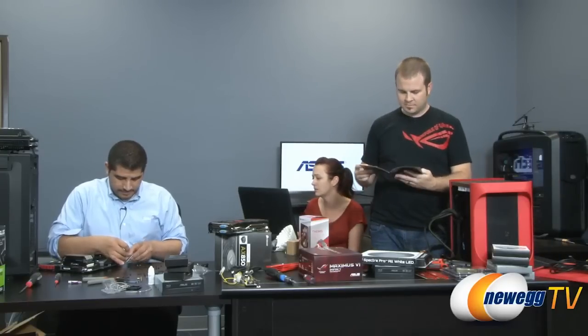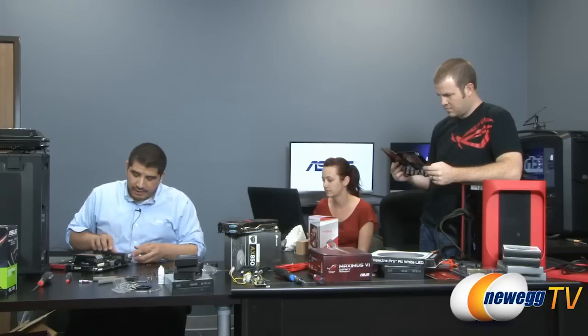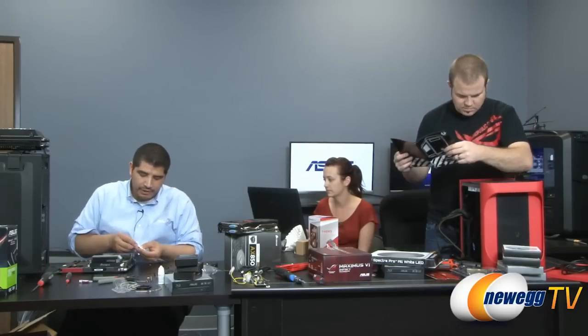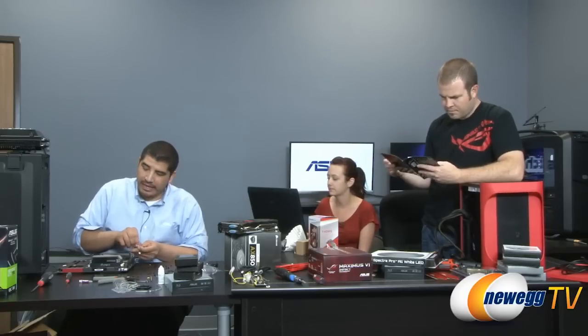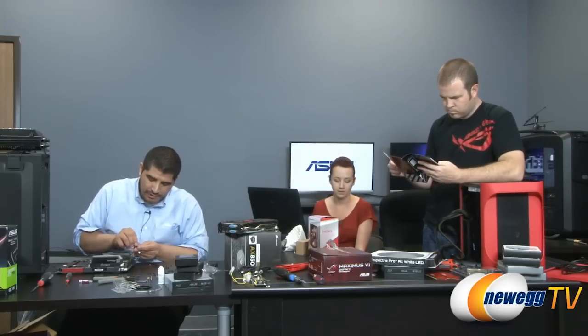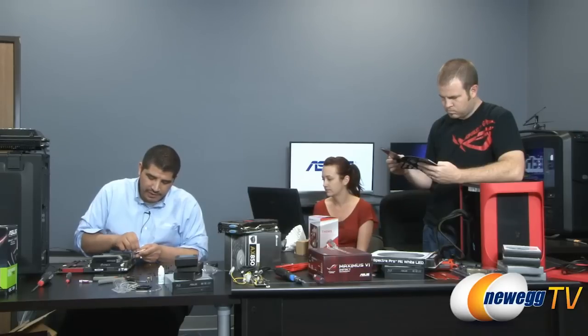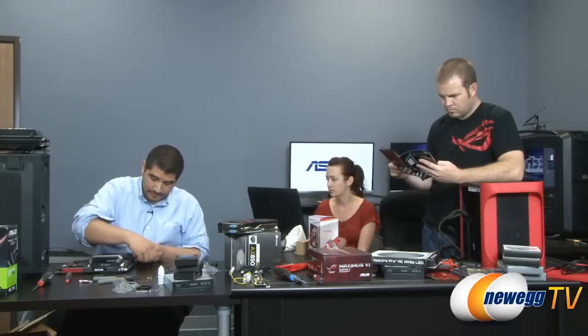Okay. Speaking of fan control customization, I've heard you say in the past that all fan headers on Z87 boards are PWM. Are they all really PWM or software controlled voltage? So you have the ability to control both DC-based fans and PWM-based fans. As far as the PWM signal in itself, that's difficult to modulate and verify. But in terms of the control parameter that's offered, we can customize the voltage increments that are being supplied, but we can also reference the data that's being set through the data lead. So in that respect, it's kind of like a combination of both, and there are some more complex elements to how the Super I/O controller interfaces with that. But as far as every one of those headers, they are fully adjustable for both 3-pin based fans, so DC-based fans, as well as 4-pin PWM-based fans. Okie dokie.